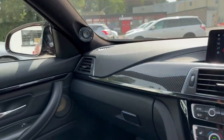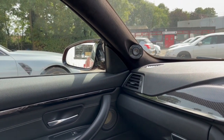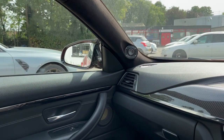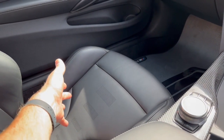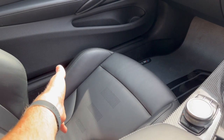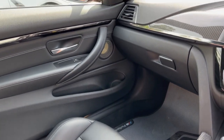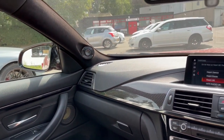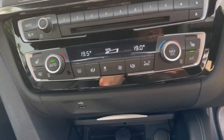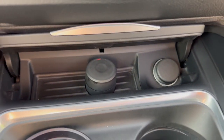We're using the brand new Audison M8.14 amplifier — an eight-channel amp. Into the two-ohm Audison woofers it's producing around 140–160 watts per channel, so plenty of drive for those under-seat woofers. It's about 100 watts to the mids and 100 watts to the tweeters, which is an ample amount of power. There's also the new DRC controller sitting here, which we use to change listening position and adjust the subwoofer level.